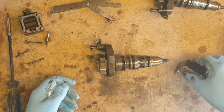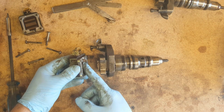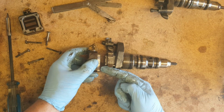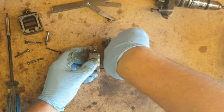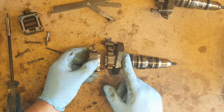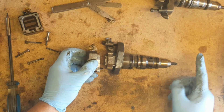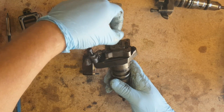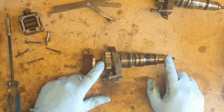The way these injectors work: when the injector driver module sends a signal to the injector to energize the solenoid, the solenoid lifts up on the armature plate, the poppet valve is directly under it, and it pulls open the valve. Your hydraulic pressure from the high-pressure oil pump enters and drives an intensifier piston — it intensifies the pressure to the fuel by a 7-to-1 ratio. So if your ICP is say 2,000 psi when it opens, nozzle pressure is 14,000 psi, and that's what the fuel is injected at. Fuel enters here, hydraulic oil enters here, goes up into the poppet valve; when it opens it forces the intensifier down. If this can't open, fuel won't inject, and that's what causes the misfire.